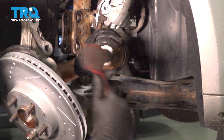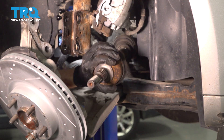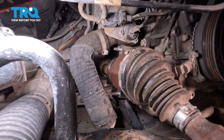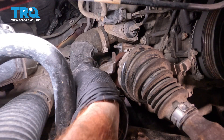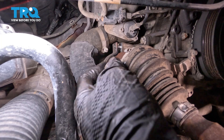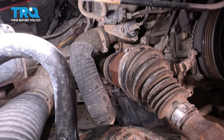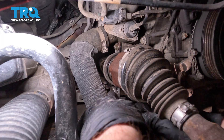We'll apply a little more pressure here. While driving that in, I can hear an audible difference. Continuing from there, let's take hold of the axle — we're going to try tugging it outward. It should not slide out. If it does slide out, it's not completely seated. Let's continue on with our mounting bracket. Get the bracket in place, start with the lower stud, and continue on to each of your two mounting nuts — start them on and snug them up.